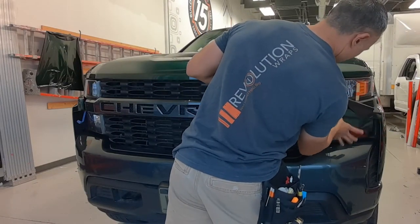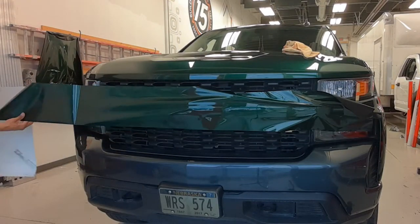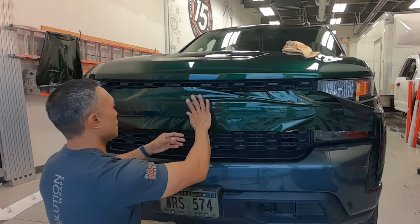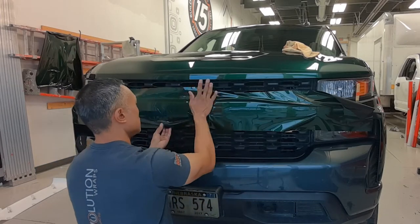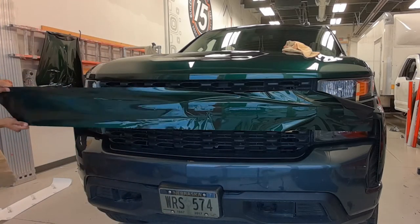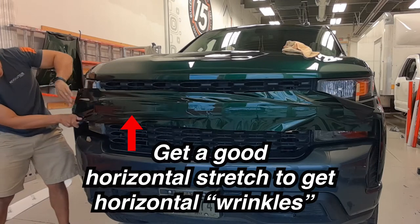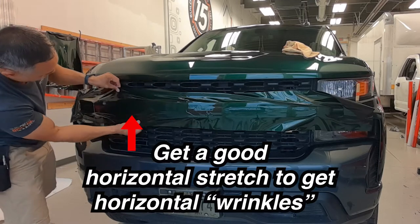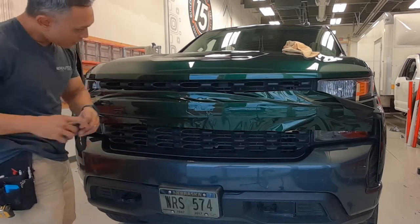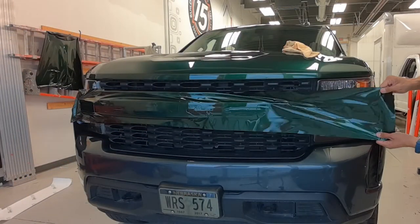You'll start with a piece that's long enough and tall enough to go across the entire grille emblem with a little bit extra on either side. Once I've got that laid down, I'm starting to anchor the center and tack it down really good. Then I go to the passenger side and start to pull and do a good horizontal stretch — I want horizontal wrinkles like you see in the arrow. With horizontal wrinkles, when I pull up and down it effectively glasses out the face of the emblem.